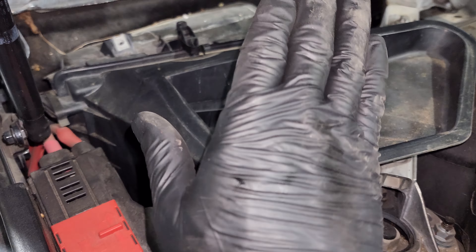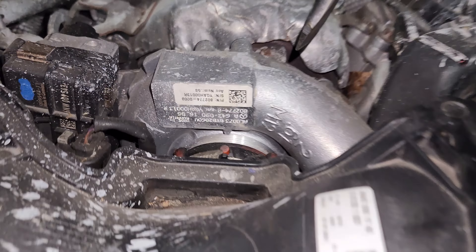To drain, you're going to want to get some pliers or something up here to turn this counterclockwise until the coolant starts coming out. There's a little dribble. Coolant should not be green, by the way — it's not the factory color for this vehicle. If you are vertically challenged like myself, I do recommend taking off the front wheels if your jack stand or lift situation makes it possible. Then you can lower the front of the vehicle down as much as possible, because there is a lot of reaching over the front of this vehicle during this repair.